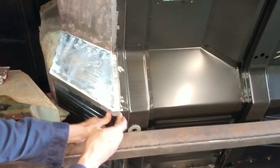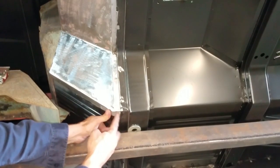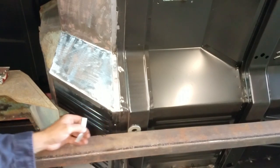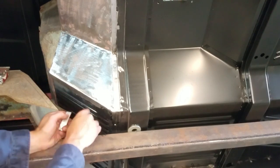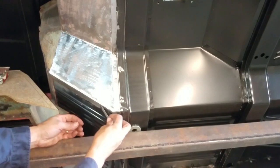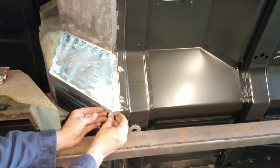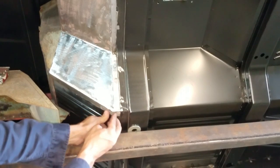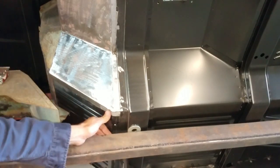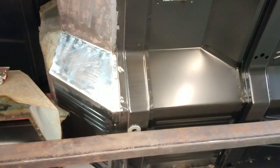There's a little indentation here — when I have it upside down I'll wipe that a little bit, just put a little filler on it and make it pretty. Nobody's really going to see it but I will, so I'll make it nice. This is another part done, so let's get this last part and we'll be done. That one's easy — I'll tack weld it in place, knock it down, then weld it out. This pan is fully seam welded on the top side, so anything I do down here is only for looks really. It's not adding structural integrity — I just want it to look nice. Somebody rolls up underneath here, I want it to look as good as all this other new stuff.